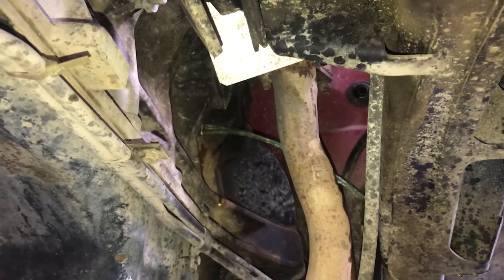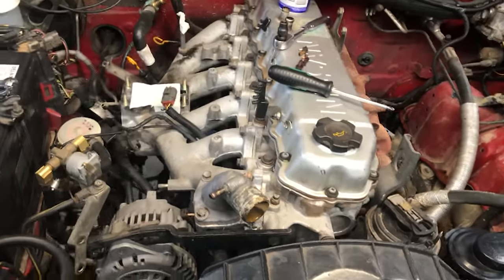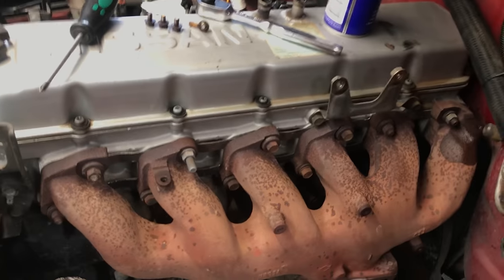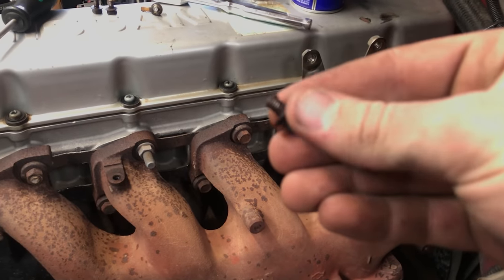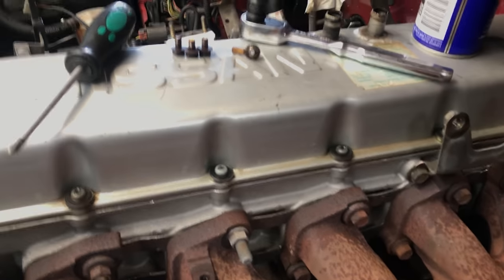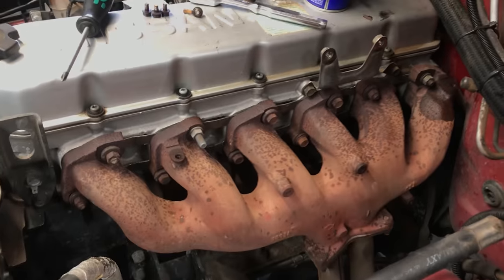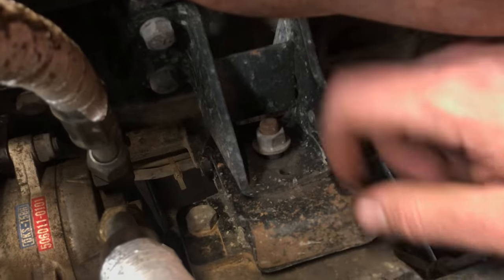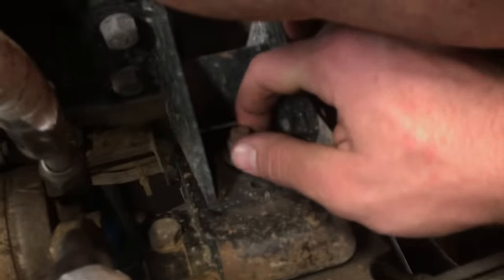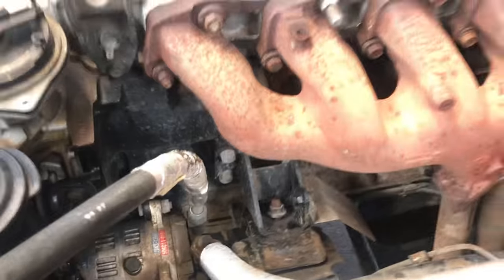Let's make a start. First step is to drain the coolant, next is to remove all the air intake system. I've stripped off the carby, all the intakes, and started stripping the intake manifold. On the other side, dizzy cap's off, taken off the exhaust manifold heat shield. As with all things on exhaust — especially manifolds — they were horribly seized. I managed to get three out of four, which I count as a success. I also noticed, as I took all the heat shielding out of the way, I had a slight engine vibration and thought it might have been engine mounts, but I hadn't had time to look into it. Then I got here, and that engine mount bolt is not done up — so we might look into that as well.